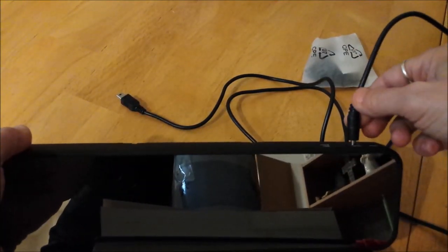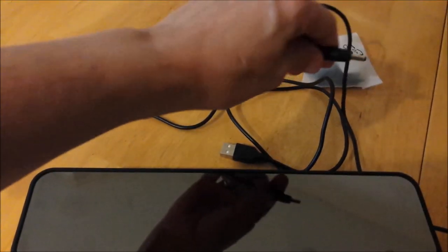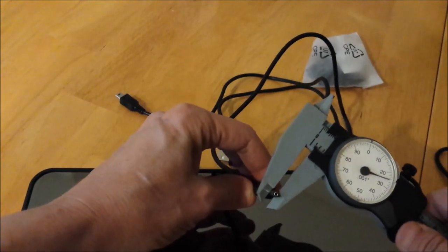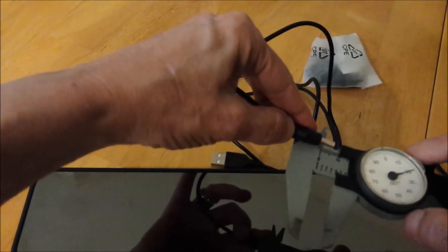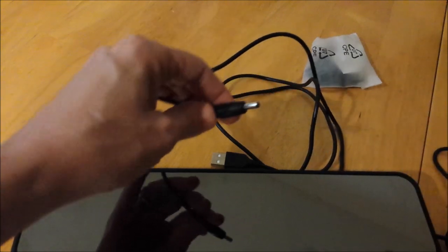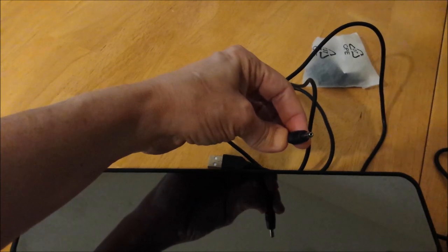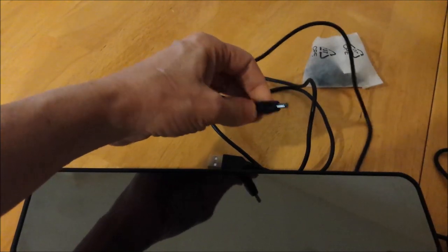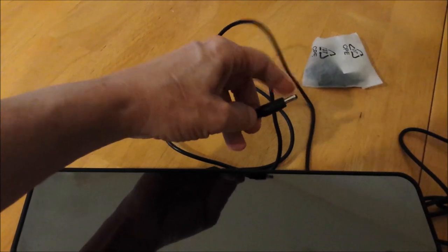For the Volt, I'm going to have to buy a right-angle adapter. I took a micrometer, and it looks like the barrel is 3 millimeters wide and the stem is 8 millimeters long. I took a multimeter — the inside is positive and the external of the barrel is negative. That might be helpful. I do plan to email the manufacturer to make sure I'm going to order the right part.